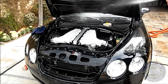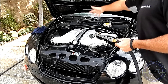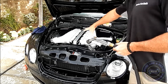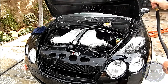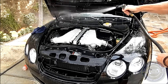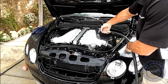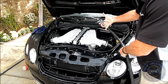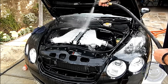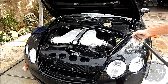We're simply going to rinse — start with the top so all the dirt can run down onto the engine that's already dirty down here. If we rinse the engine first and then went to the top, your clean engine would become dirty once again, so start with the top. I prefer one of these adjustable trigger spray adjusters so that if I have some sensitive areas I can use a little tiny pressure controlled right at the nozzle, but for the most part I'm going to use full pressure because this engine is relatively safe and there are not too many areas I have to be overly concerned with.